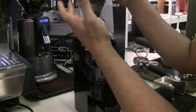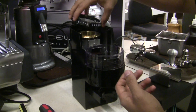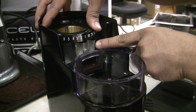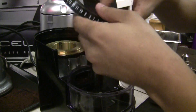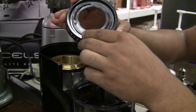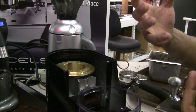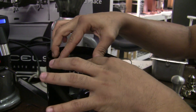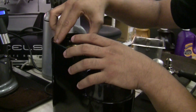I'm going to go ahead and remove the bean hopper and attach the number guide. Since this is zero, this is your zero position. I'm going to place it right here and have the stopper stop it right there — so I have one lined up right in the front and I'm good to go. On the number guide there are little channels, and that's where those nuts will go in. There's room to basically adjust it and re-zero it without having to take it completely apart if it's just a minor adjustment. To re-calibrate it you can, in essence, loosen the screws, back it off just a little bit, tighten the screws back on, put the bean hopper on, and you just get a little bit more range in the fine region.